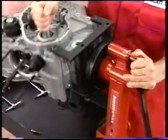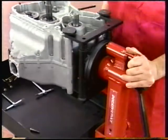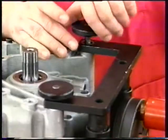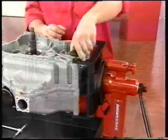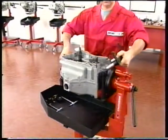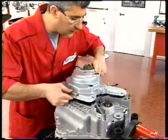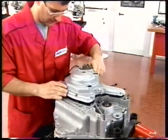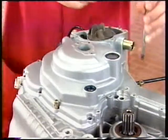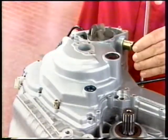Turn the casing over on the stand so as to set the chain side up. Unscrew the two knobs and remove the bracket of the stand. Refit the generator cover to the casing, ensuring a correct coolant pump shaft timing lay shaft fit. Secure the cover to the casing, fitting three screws at the opposite ends of the cover.